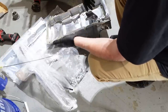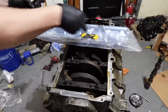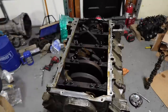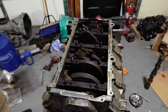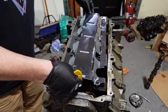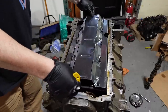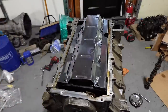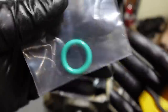Ta-da — all the things. We'll start putting them in the vehicle. It's gonna go right about there. Razor it open. Easy way to clean up your tray here too — just throw out the old one. A little pump pickup tube and o-ring — here we go. They give you the big boy ring with this one. Can you see it? That's thick with two C's — should be perfect.